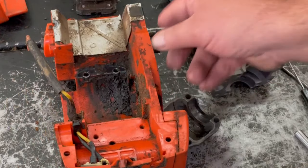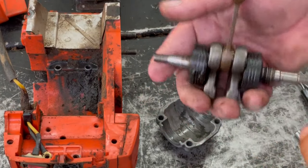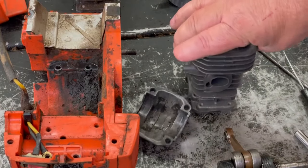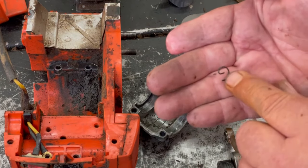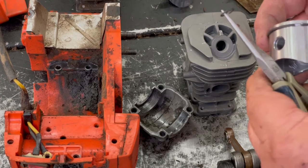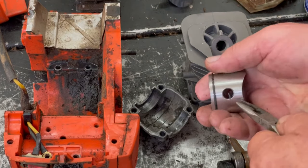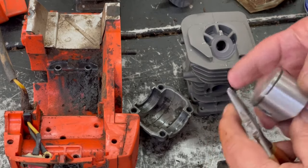You get your case — this side here is where your bar and everything sits. This is your worm gear for your oil pump. The crankshaft is going to sit like this, and here's the intake, here's the exhaust. So that arrow is going to point that way. Here are the new clips — it's a good idea to use needle-nose pliers on them to get them started. I like to get one in on one side first, then make sure it fits in that slot and turn that keeper to make sure it's locked in.